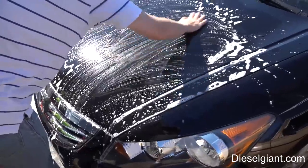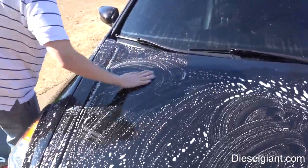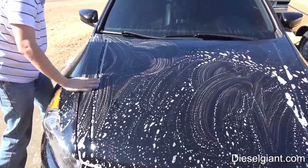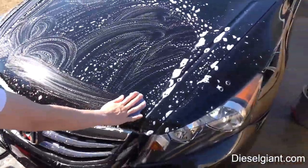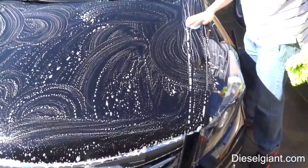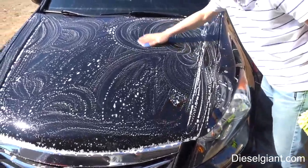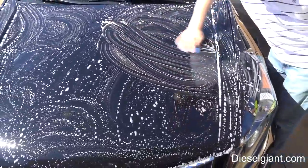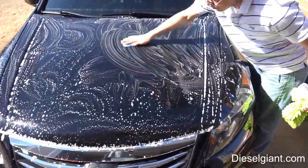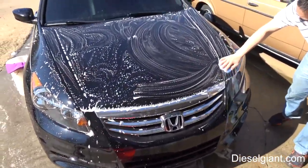We do this first, and normally after the car has been buffed and we put the Adam's paint sealant on, he'll only need to do a light clay barring next time — no buffing — because he's not going to wash in a commercial car wash anymore. Honda paint, especially the black paint, is pretty soft and scratches and swirls very easily. When clay barring you can do it in circles or back and forth; just make sure you get everything. Once we finish the hood we'll do the front end and side fenders, wash it all off, and be right back.